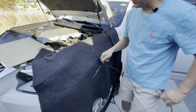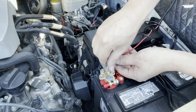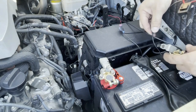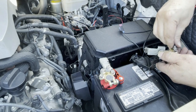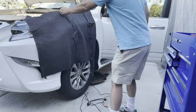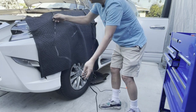Now we work on the light bar. This is the power line supplying the light bar — I'm going to disconnect this off the power and put the screw back loosely. I take the power line and set it aside. Then disconnect the ground cable off the negative terminal. There's a lot of spaghetti wires around here. After removing the ground, I set the light bar assembly aside. These are the two power and grounds I'll be working with when installing the fuse panel.